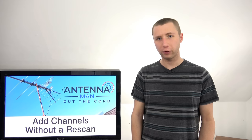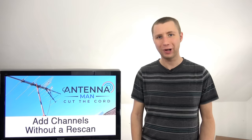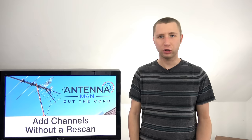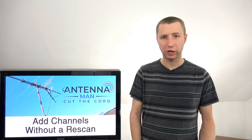Now there may be a few reasons why you want to manually add a TV channel. Most people say just run a rescan and it'll bring it back — but that isn't always the case. For many people, especially with the FCC repack screwing things up, they may find themselves in a situation where they lost a channel or two, tried running rescans, and it just doesn't bring it back. So instead of running endless rescans, there is an option to manually add a TV station based on their RF channel on many TV sets.